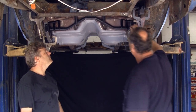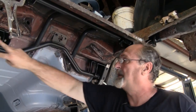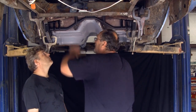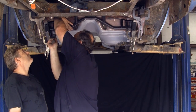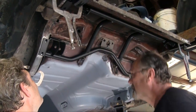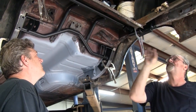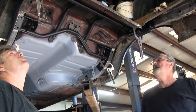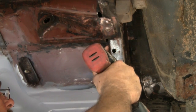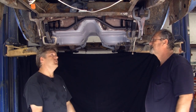What you want to do is come in with a felt-tip marker and mark the holes in all the locating places. Mark these two, mark these two, and then come over here and do a little adjustment on this side and mark your holes here as well. Then you pull it down, drill those holes, and slide the U-bolts through there. We've already drilled the holes, so we'll just show you how to slide the U-bolts into position. You've got seven of these little U-bolts to go in.